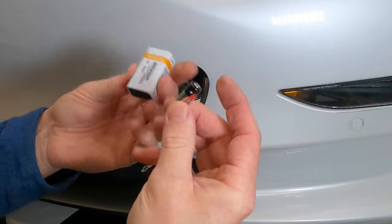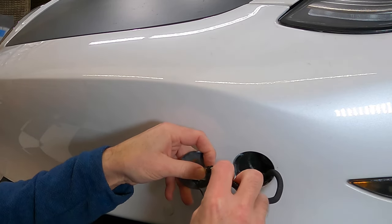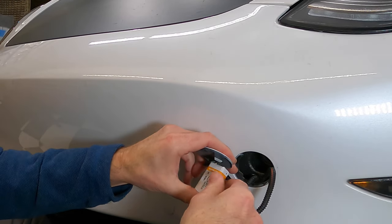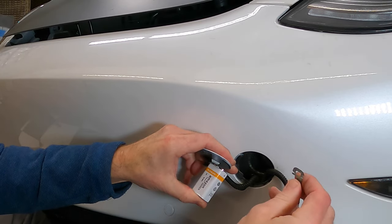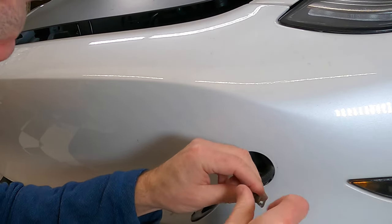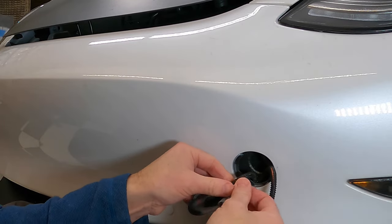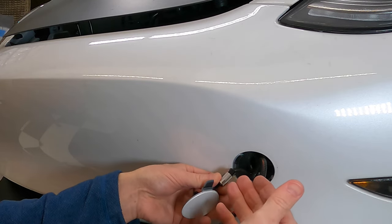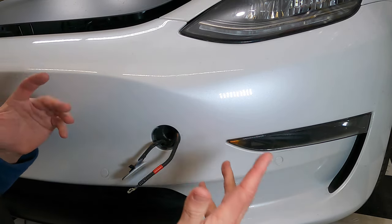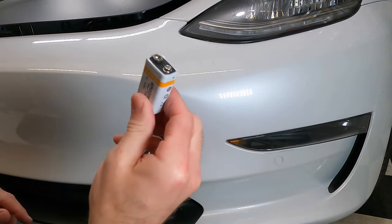This A23 is actually pretty cool — it's a 12-volt battery but tiny, and I'll show you why that's great in a minute. You can also use a 9-volt — a little bigger but by no means big. So open the car — wham! See that? Now I'm going to clean these terminals up a bit, cover them with electrical tape on both sides, tape this up, tie it here, and now I have a way to get into my car in case of emergency.